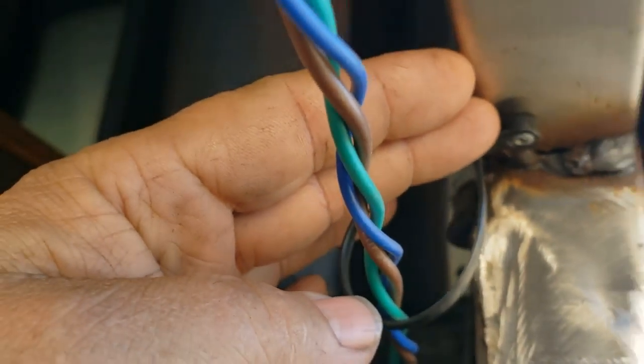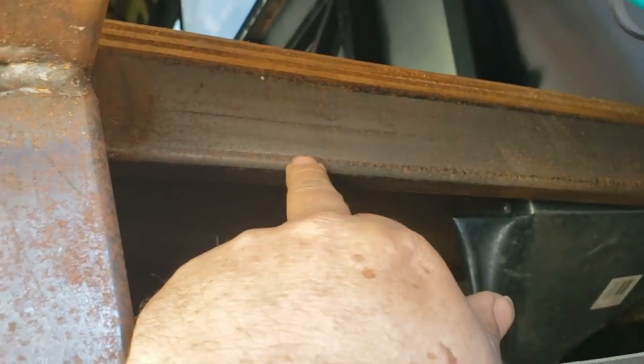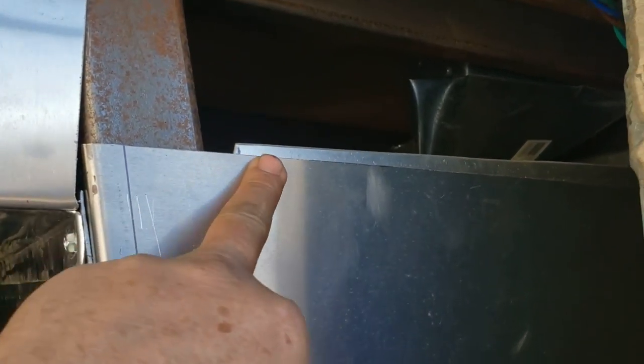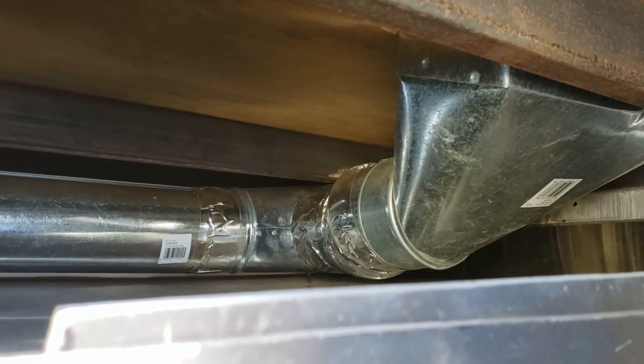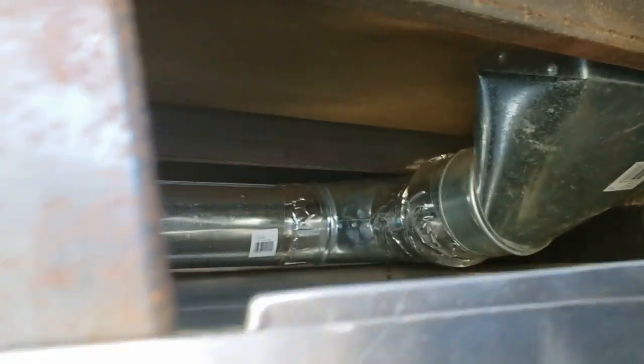That's got to be all boxed in from this height here back to here — camera's getting in the way. Originally my plan was to have aluminum skin with aluminum here and have two inches of insulation on the inside floor, but as I tend to build on the fly, I found that if I drop this down — this is the height of the top of the toolbox back here — dictated by the ducting that comes across the top of the radiator. So I decided to drop this all down and close that in inside.